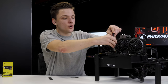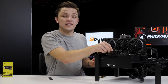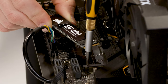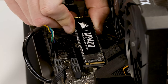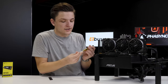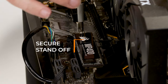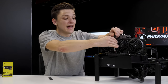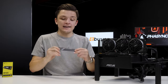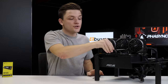In order to install the M.2 drive, we need to fasten it under a retention standoff — that is this screw here. Take this screw out, as it's going to ensure your M.2 drive doesn't go anywhere. To secure the SSD, find the gold connector on the end of the drive and locate the notch, then line this up with the corresponding notch on the M.2 slot and slide the drive in at a 45 degree angle. Then take the original standoff screw and fasten the M.2 drive down into place. That singular M.2 connector provides both data and power.